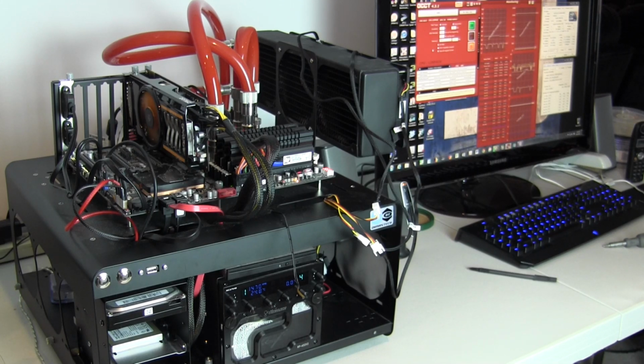And then I'm going to run it at a higher overclock, at 4.68 gigahertz, but I had to crank up the volts. This guy doesn't seem to like anything above close to 4.7 no matter what I do. So I was able to get a stable overclock with 1.535 volts on the CPU core. The base clock is at 167.5 and the multiplier at 28. So that's going to generate some heat, and we'll see how it dissipates.